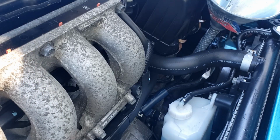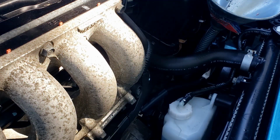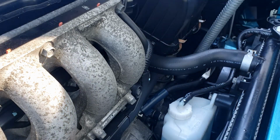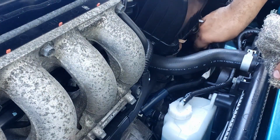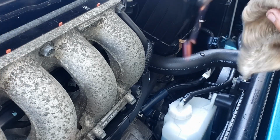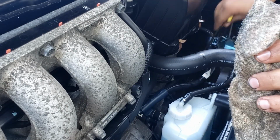This bottle feels like it's about out. Just that little glug there. Make sure everything's working its way down nice and proper. Take that out. Try to run it through all the gears as well before you do these final steps there. So as you can see, the oil is literally right up at the top mark exactly. So this is perfect, and we are done here.